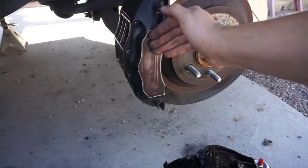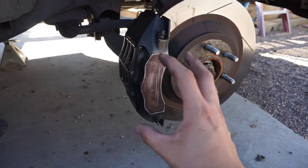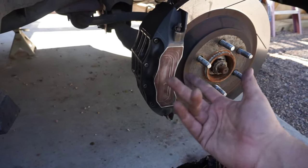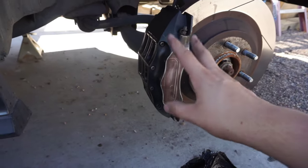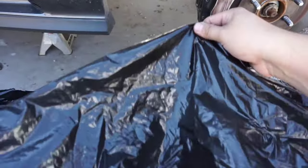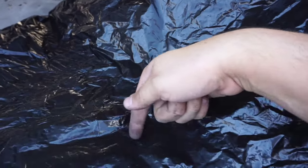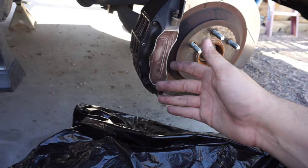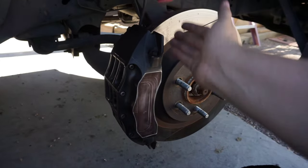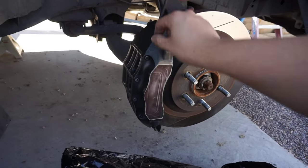All right, so we got this all nice and smooth. You don't see the crinkling or the peeling of that little coating anymore. So to mask them, quick trick: get a trash bag, cut it on the bottom and on one side so it opens up. Then cut a little slit about half the size of the caliper. Stretch the bag over the caliper and let the tension of the bag go around the caliper itself to protect the rotor. Then tape out to wherever it reaches, and tape off the little drain plugs and all that stuff.